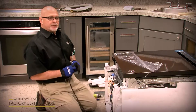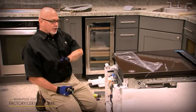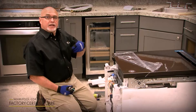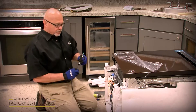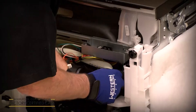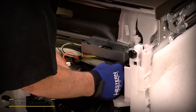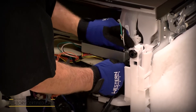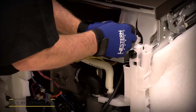For a hard wire installation, you would do that further along in the installation — you'd have it taped to the floor, slide the dishwasher into the cutout over the hard wire, and hook it up at that time. For a power cord model, you're going to do it while you've got it on its back, hooking up the water supply, electrical, and drain hose. Always make sure you use a strain relief on the power cord or hard wire.